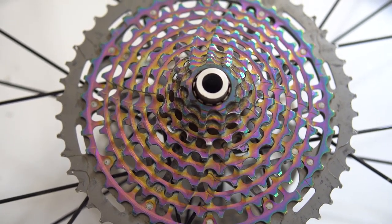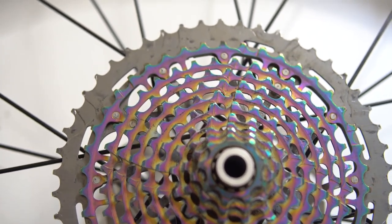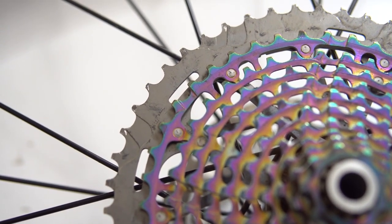The stock Eagle cassette is a lot more expensive but similar weight to this. The big thing for me is that 9-tooth cog really changes what you can run for your front ring. Most cassettes go down to an 11-tooth on a standard freehub body — going to a 9 is basically like adding six teeth to your chainring in the front. Most gravel bikes come with a 40-tooth chainring with an 11-tooth smallest cog. That 40-11 gear range is your fastest gear. Having a 34-9 is essentially the same gear inches, so your top speed would be identical between a 40-11 and a 34-9. Your top end doesn't change, but on the climbing end, now you have a 34-50 instead of a 40-50. That's really where this setup shines. I've been really liking this cassette and will be doing an independent review for it on this channel.